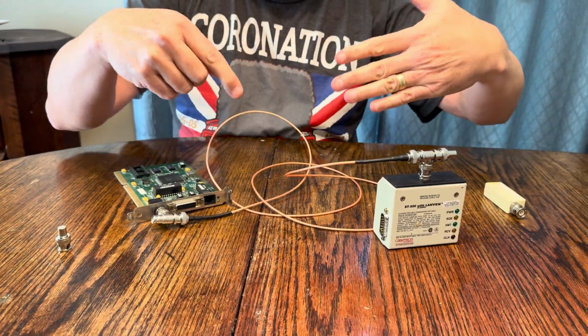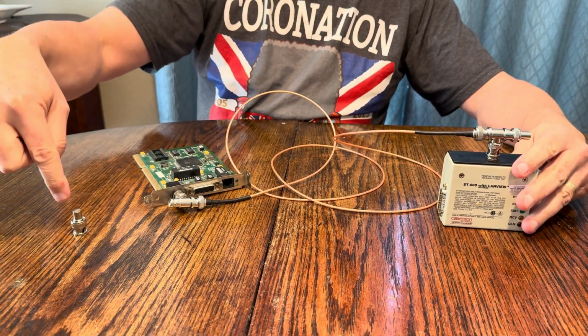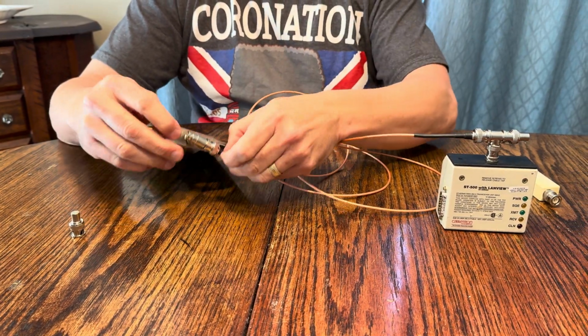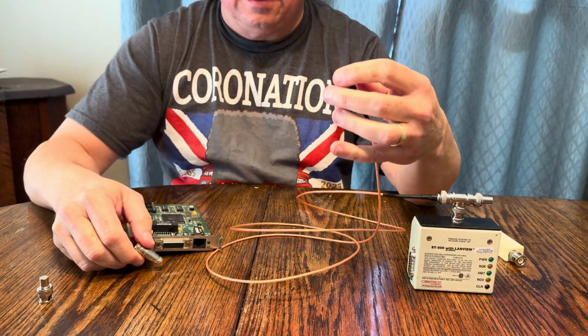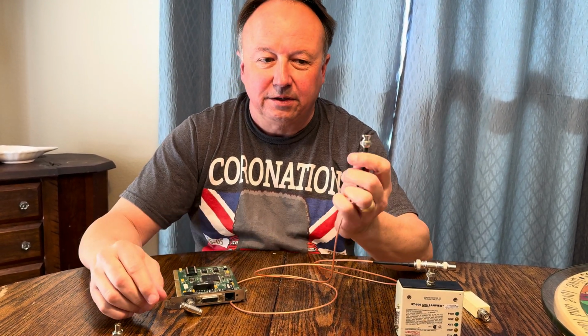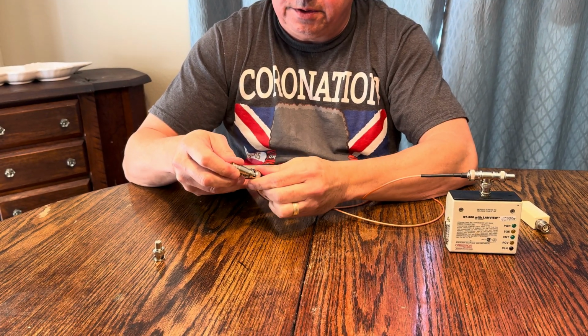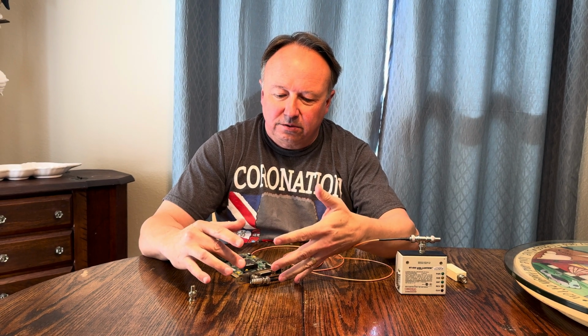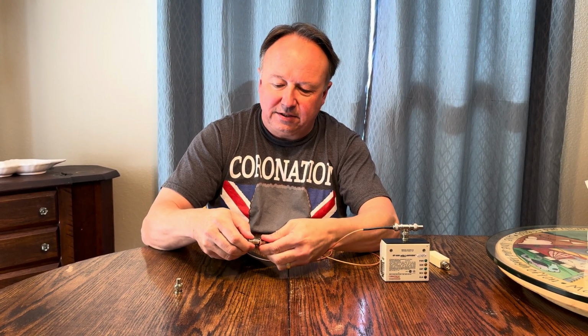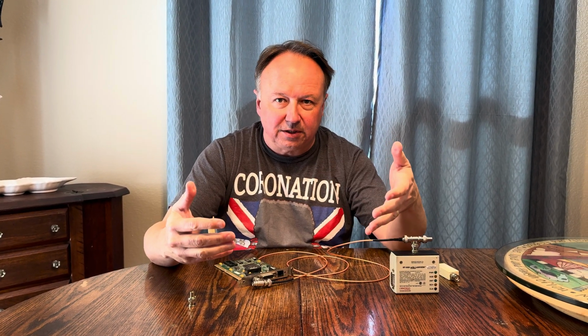And what you would have inside of a lab or something like that is a series of computers all daisy chained together with these little connectors. And then, of course, if somebody came along and unplugged one of them like this, and they almost would never terminate it, it would bring the whole network down, and everybody would be down until you hunted down where this connector was broken. And if you had a big network, that could actually take some amount of time. Later in my career, when I was seeing this getting deployed, people started moving to hubs where it would be basically one connector per computer or a very small number of computers, so that you didn't have that one broken cable as a vulnerability to bringing down your whole network.